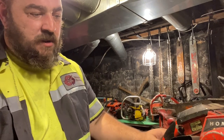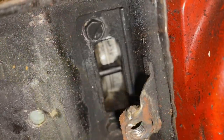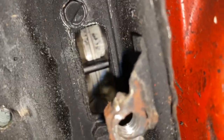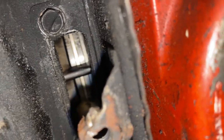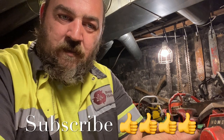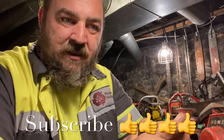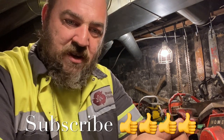Today we're gonna check a few things and see what we're gonna get into. It looks like we're gonna have a little bit of scoring on the piston to deal with. The cylinder might be okay — we do have a little bit of scoring there. Let's go ahead and move forward with a compression test and test for spark. We kind of need to knock those off the list and then we'll finish off with checking our squish.